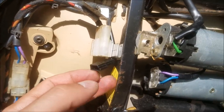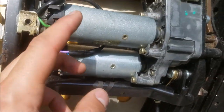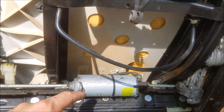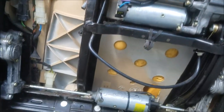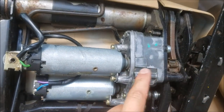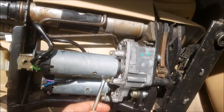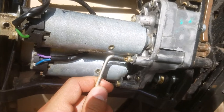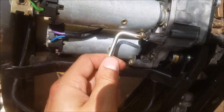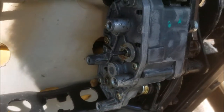Here you can see the connectors a little better because I've got the whole seat flipped over, and here are the wires. You have three motors controlling the various seat movements on this vehicle, and then you have several gearboxes. The one we're after is this one right here — this is the one that has the gear that goes bad. To get to your gear, you're going to need to remove these two motors first. You've got to remove this top motor first — it's a T25, only got two bolts, one here and one there — and the same for the bottom one.